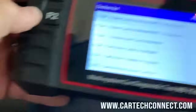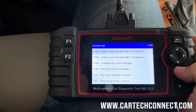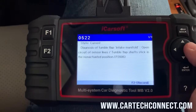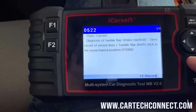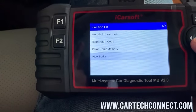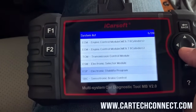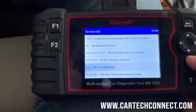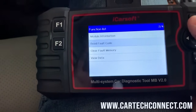The scan is done. Going to go to the six-cylinder engine module and see what codes are in there. Only one code — for the intake tumble flap. Well, that's not going to help. We'll get out of here and go to the air conditioner, because that's what else turns the fan on. No fault code in the air conditioner. So far we're going for two — might have to actually use brains on this one.